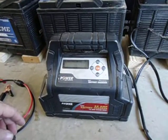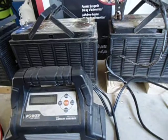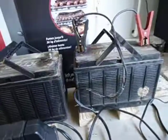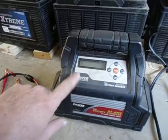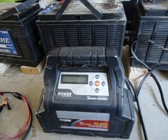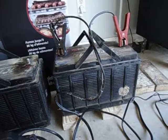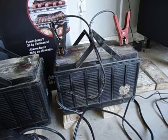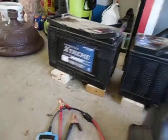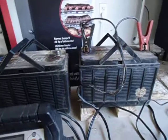I think I'm actually doing some good on this first battery that's been reconditioning for almost 24 hours. The internet says it might take two, might take three days. You can see the size of these batteries — they ain't cheap. So it's worth some of my time to see if this smart charger with recondition mode will do any good. I'll give you an update after I get this first one done, whether or not it took the charge and desulfated. These are still rated at 925 cold cranking amps with a 190 minute reserve — pretty substantial batteries. Anyway, it's worth a try, we'll see what happens.